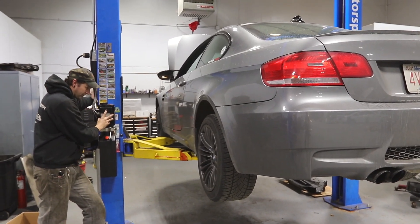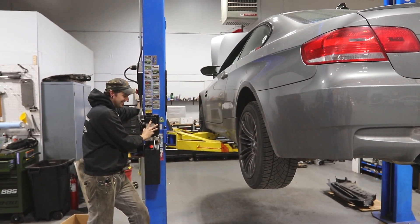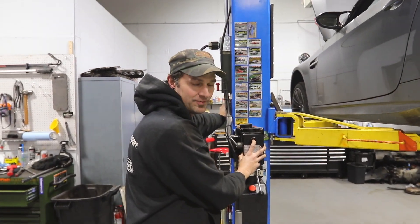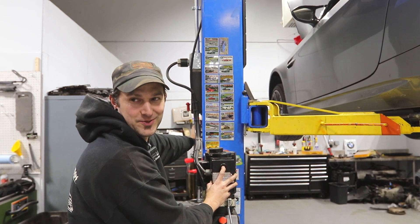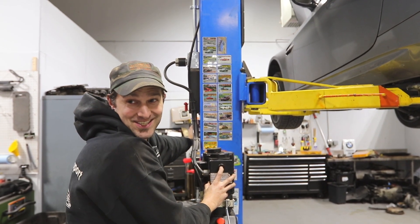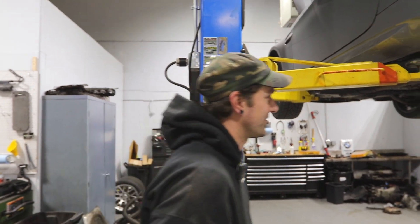As much as I love under trays, it really sucks because you can never tell if your car's leaking anymore — until it's really bad. N52, N54, N55 engines that consume the belt into the front seal: there's no real symptom. It drips oil onto the belt, causes the belt to swell, it doesn't smoke, it really doesn't leave a mess — it just gets caught by the belly pan. And your first 'too late' symptom is low oil pressure on the dash.